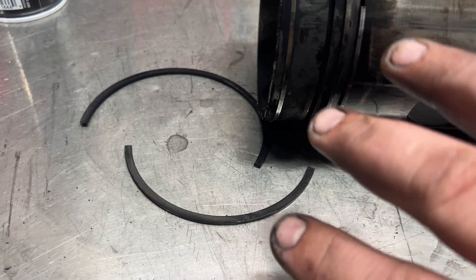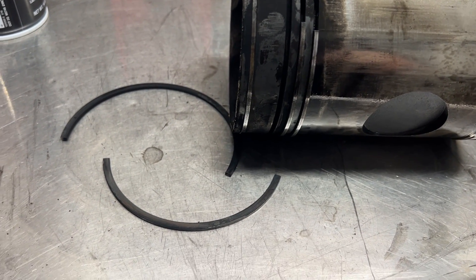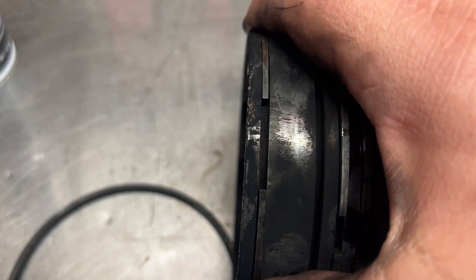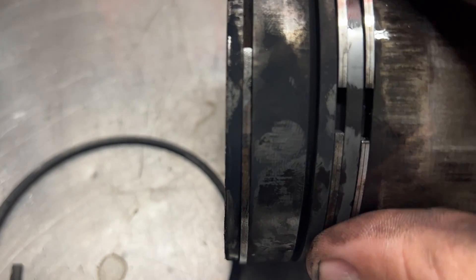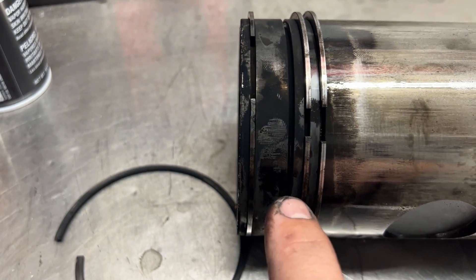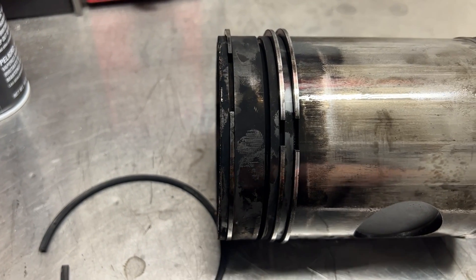This is the cylinder where there was soot all at the top and it was blasting out from the ring. It had a broken ring on it, and then this ring — look how big that gap is. It's missing the end of it, a big chunk. The ring gap is only supposed to be like that — this one's like an inch and a half. You can see all the soot on the top of the piston. Obviously this ring was doing nothing — it was broken — and then compression wasn't happening until way down here. Can you imagine how low that compression would be?